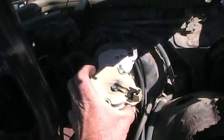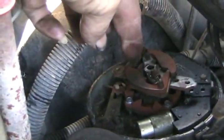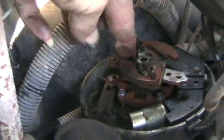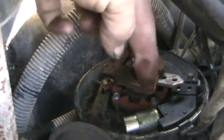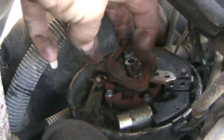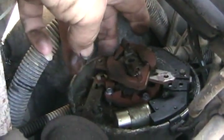Of course, that's what it's supposed to look like. When you get this off, that's where the rotor sat. Just check your springs for your advance weights and make sure everything returns. Sometimes these little pins that these pivot on seize up, sometimes springs are broke, and it advances too quick. Then every time you accelerate, your engine has a heavy pinging sound.